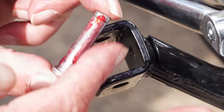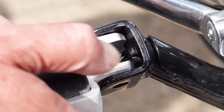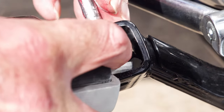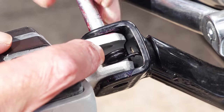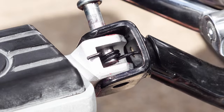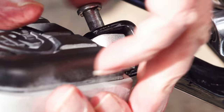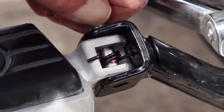A bit of grease on your clevis pin also helps. Now this is the tricky bit — luckily Royal Enfield haven't used as heavy-duty a spring as those used by Triumph, which makes fitting a little easier. But getting the hole through the spring, the holes through your footrest, and the hole through the footrest mounting bracket all to line up is always a little bit tricky. Perseverance and patience are required, and you might need a little assistance from the screwdriver just to coax the spring into position. Make sure the straight long end of the spring engages into the hole in the fitting bracket and that the L-shaped end sits over the top of the actual footpeg.